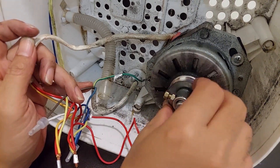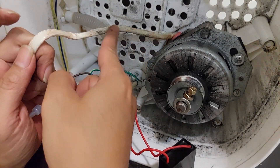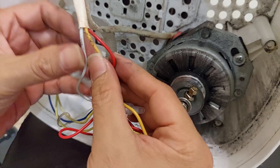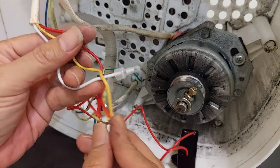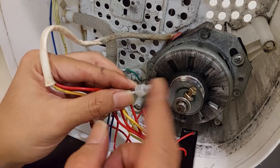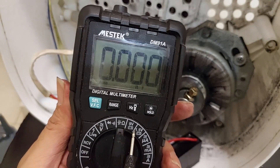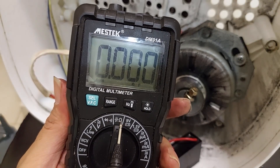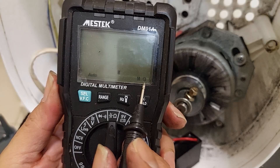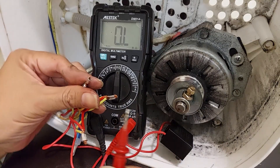The next step is to check whether the motor is still working. As you can see, there are cables coming out from the motor — 3 cables, two going to the running capacitor and one to the electricity. We need to open this also. To test the motor, I use my multimeter on the resistance (ohm) position. From the 3 cables coming out from the motor, there should be some reading.